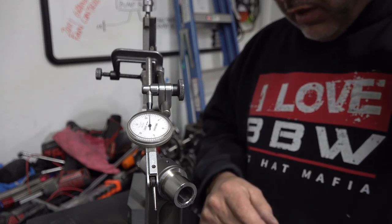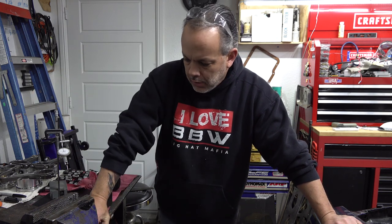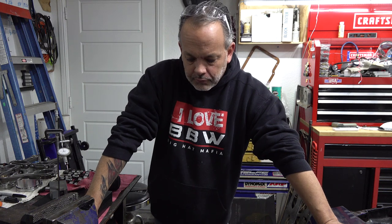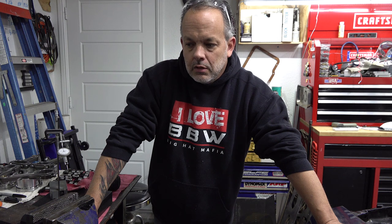I may even go ahead and take one of the other ones apart just to check it to satisfy my curiosity. So I went back and rechecked all of the pistons and rods — I took all of them apart. Every one of them checked exactly the same or very close to the same when I started using the test indicator instead of the height gauge. I'm pretty confident everything's okay there. The one thing I noticed is that all of the wrist pin bores in the pistons themselves are a little tight. The rod bushing bores are fine — the wrist pin slides right through them using just your thumbs — but I'll probably have to hone the pistons just a little bit to make sure they float freely like they should.